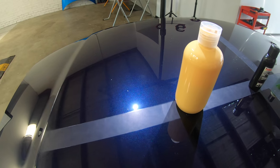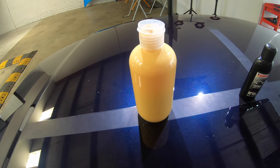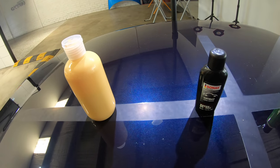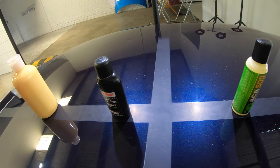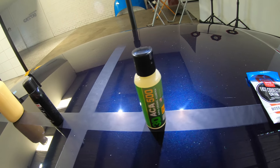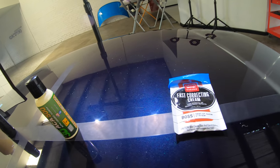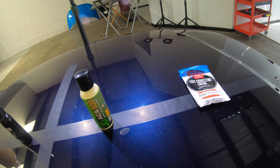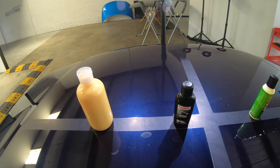3D ACA really stood out here in one area, which was obviously its leveling ability, as it really did consistently outcut the other two compounds. But apart from actually not dusting all that much, which is great, its overall user experience wasn't anything great, nor was its finishing ability. Which really means that it'll never be a single stage compound, and it'll always require that follow-up stage, which I'm also guessing is exactly how it was meant to be used.